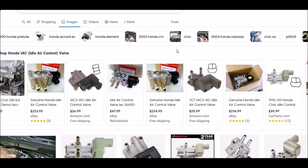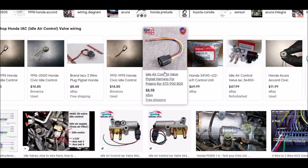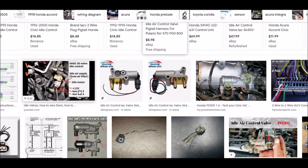If it's more like $200, you can just try to clean it up and put it back together. And you might have some good luck with that and it might start working. And the next thing would be the wiring that's going to the idle control valve. You're going to have to Google your particular year and engine to know exactly what's going on. But you should be able to check the wiring for any opens or shorts and check that the voltage is coming in correctly, and be sure the harness is good. Because bad wiring can be the same thing as a bad valve, so be sure to check that wiring.